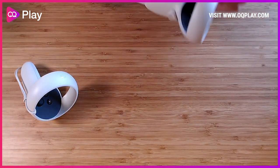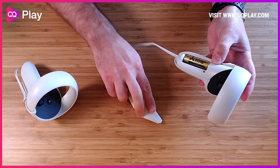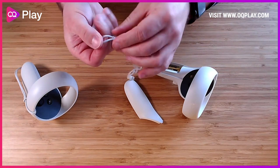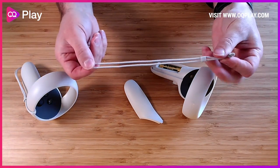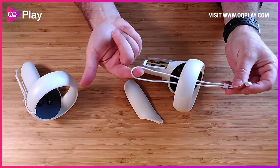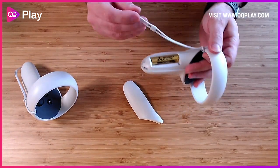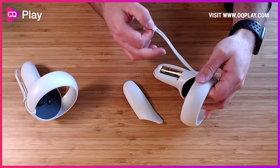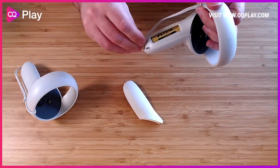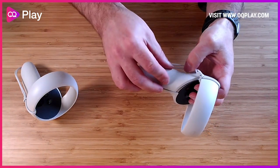Now for the left controller. As you would have got it, the cable is attached. Simply remove the battery compartment, take your nail and bring that tab up and out, and you have the cable again. Bring the slider all the way down to the connector end so you've got the loop. Take the loop and pass it down through the hoop, then take this module, bring it through the loop, and pull it tight. Once tight, bring the slider all the way up, and bring this bit around so it's flat into the connector, then connect it back in.